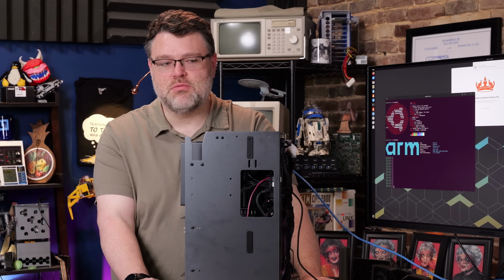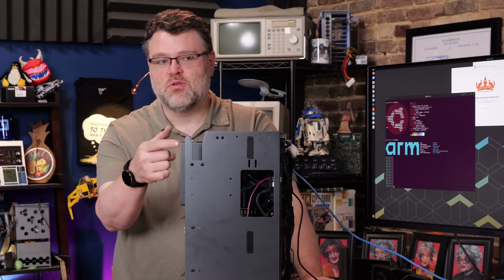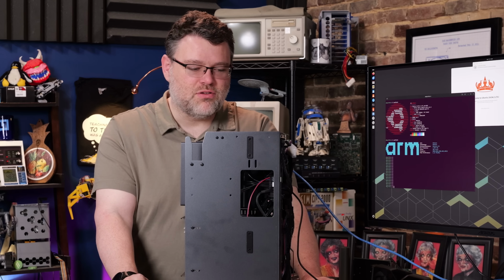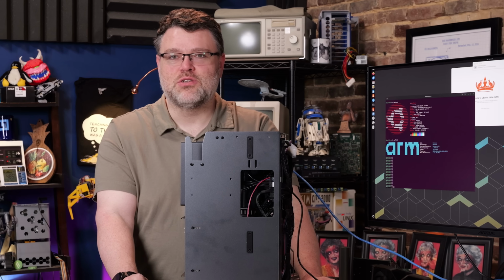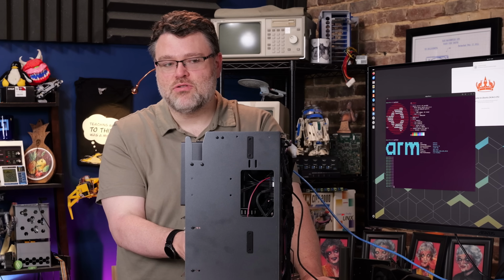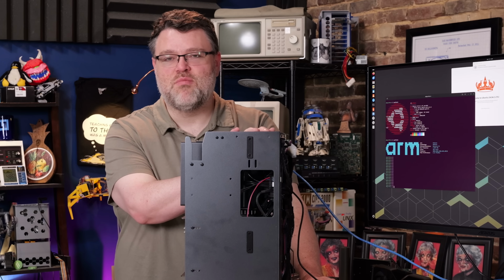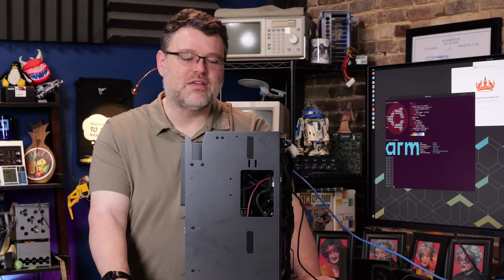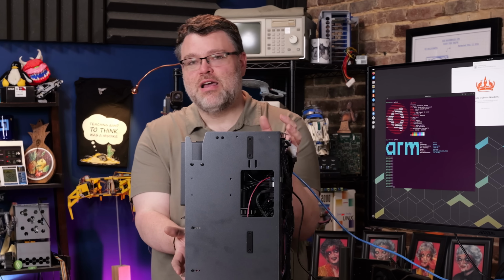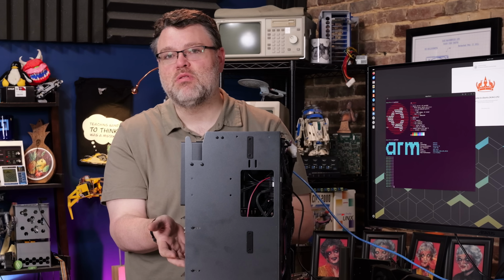I mean, sure, you can do temperature monitoring, and this board can read what the motherboard is requesting off of a fan header, but this can also be dealt with in a little bit more of a controlled fashion, as opposed to just run the fans at 100%. Out-of-band management on this does also let you control the fan headers and everything else like that on this ASRock motherboard. So the ASRock out-of-band management we'll talk a little bit about in a second. But there's a lot of hardware engineering here that is easy to look over because it is well implemented for what it does.